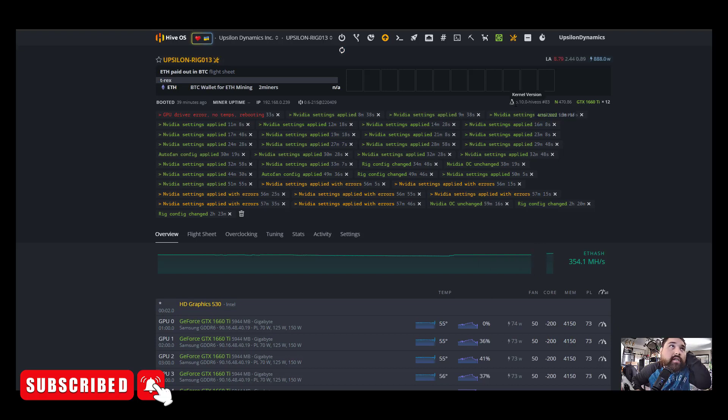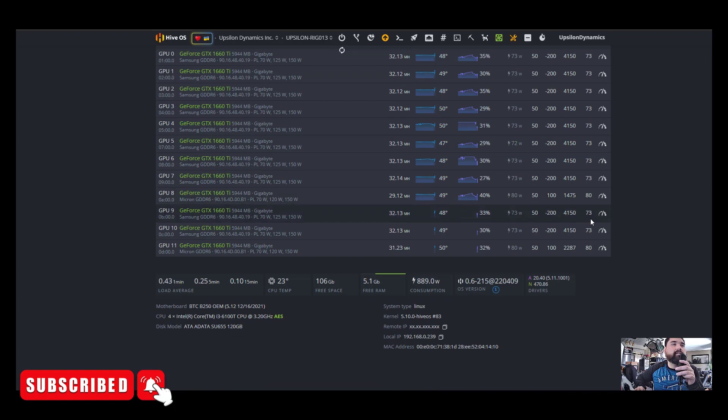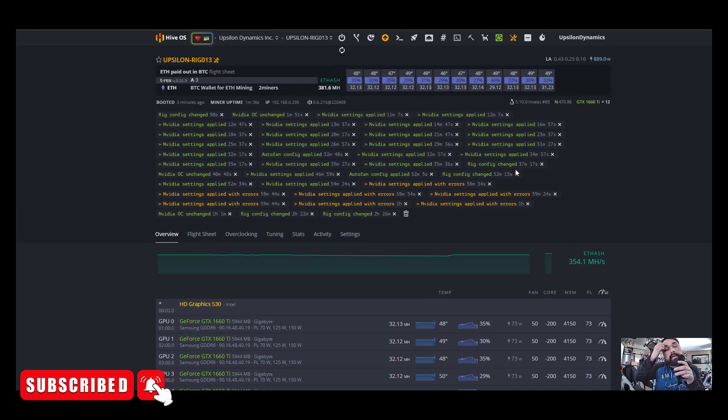When I set this card to 2000 and above, it's just crashing. The threshold on this one is about 14.75, which gets only around 29 mega hash. It looks like a case of silicon lottery bad luck. The rest of the cards are getting around 31 to 32 mega hash. After rebooting, we are at 381.6 mega hash on Ethereum with these 12 1660 Tis. This card cannot handle any overclock above 14.75 — if I push it past 15, it will crash and not boot up properly regardless of the power limit. It's one of those bad apples. If you're building rigs with a lot of different GPUs, you'll find some are champions and there's always a few problem childs lagging behind.